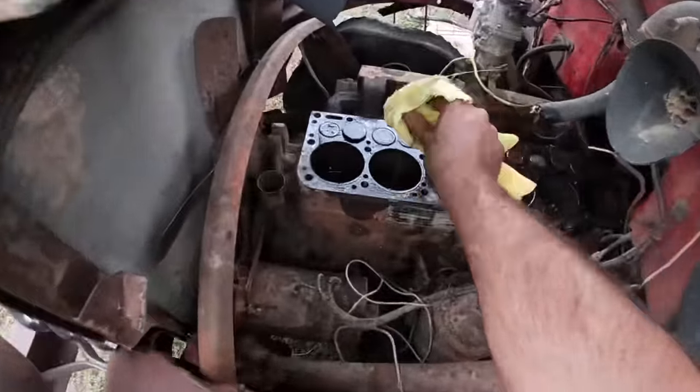I'm going to clean that up — not going to show you guys that part because the shop vac is really annoying. Hopefully by the end of the day we'll have the head on this thing, and tomorrow morning we'll fire it up. So I cleaned the cylinders out one last time. Everything's looking good — the valves are relatively clean, there's no real rust on them, just a little bit of buildup from leaded gasoline. I've got the head gasket saver right here and we're going to spray this head gasket down, then throw her back on.